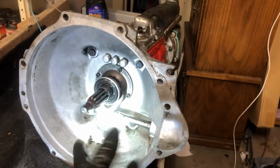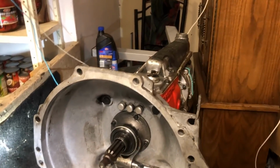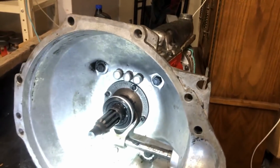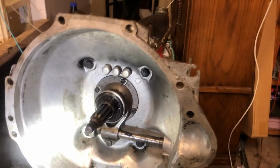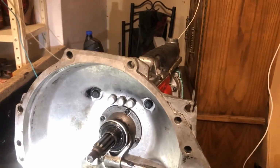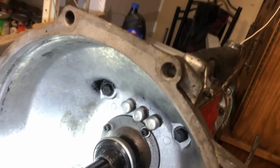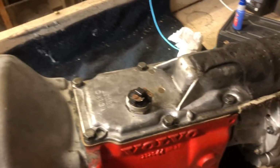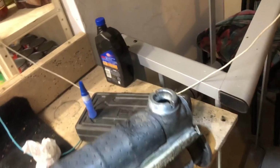I like the mechanical shift fork. I think that's great. Going to be probably trouble-free for many, many years. The four bolts on the ring here. The smaller transmission in the early cars have a three bolt ring, and those bolts have their own O-rings, so you do want to make sure you seal them nice and tight with new O-rings, as well as using Loctite, because front main seal leaks are possible, and I've actually had to pull transmissions back out because I didn't use Loctite on those.